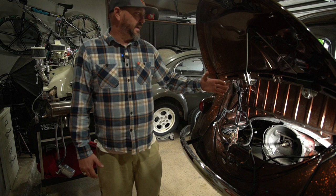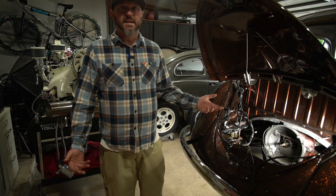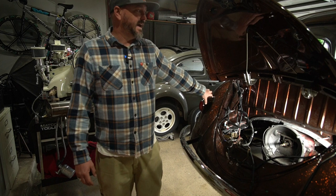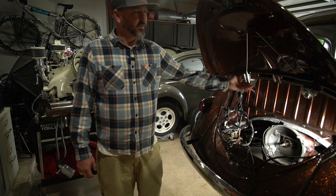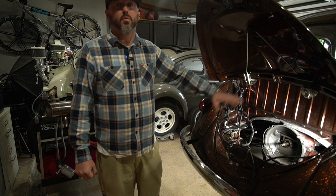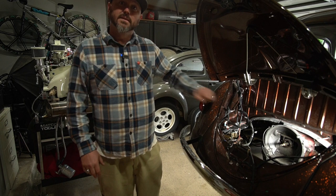Today this will be easy, super quick and easy. All we gotta do is hide those wires. I've got some ideas. Luckily everything is long enough. I only have to do one sketchy thing - I'll warn you before I drill a big hole in that nicely painted firewall. I've got to get this harness out of here and that's the fastest way. We're gonna punch a hole, run these wires out, reroute them, tuck them in, zip tie them, and get them out of the way. Then this engine bay is gonna be super clean.